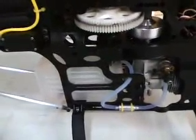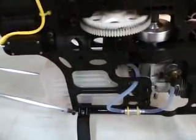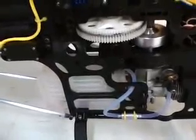There's no hopper tank on this helicopter — it flies for nine minutes plus easy with the stock tank. If you're learning to hover, you don't need one. Even if you're doing 3D, just set your timer for eight minutes, stop 3D at eight, and keep 1G on that tank. The downside here is a tired OS 50 Hyper engine.